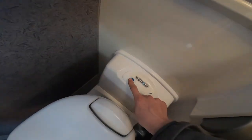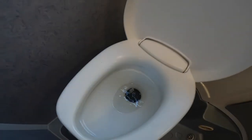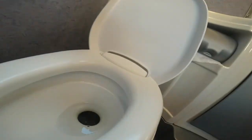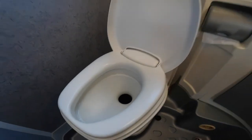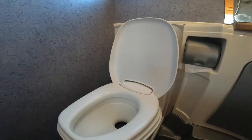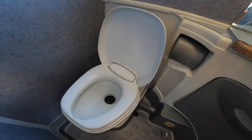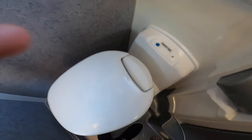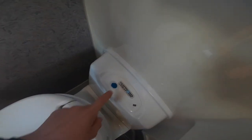To operate the toilet, make sure the pump is on. On the back you've got a blue button — just press it and it will flush the toilet. Always flush before use to lubricate the seal between the blade and the cassette. On the side is a grey lever — slide this to the right to open the blade and everything will go into the cassette. Once finished, flush and close the lever — the blade lever — back to the left-hand side to the shut position. If you're buying the packs of blue and pink chemical, the blue goes into the cassette. Use a spray bottle to dilute it, spray the bowl and then flush.